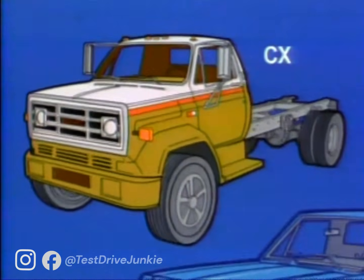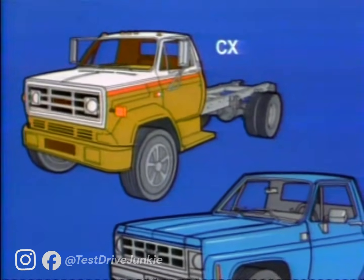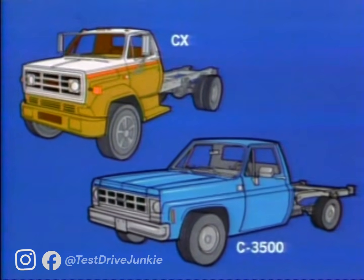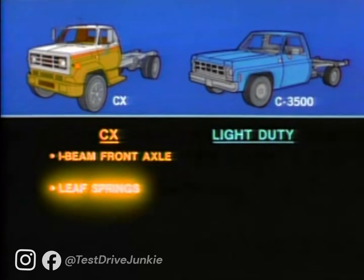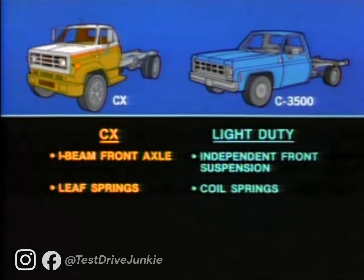The entire CX series has some important similarities to 1-ton light duties. For ease of entry, the CX also has a 72-inch and 102-inch CA dimension, just like the 1-ton cab chassis, and the same loaded rear frame height as the lighter capacity 1-ton truck. But unlike the light-duty 1-ton, CX gas models have a 5,000-pound I-beam front axle with multi-leaf springs and kingpin bushings instead of a 3,800 to 4,000-pound coil spring independent front suspension with ball joints. Diesel models come with a standard 7,000-pound front axle.